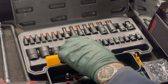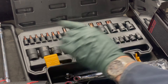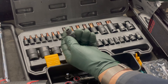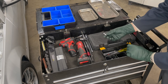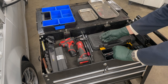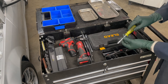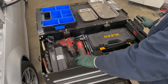I believe the most important thing you'll need is a good set of Torx bits. I like these because you can actually read them — T40, T30. And here are E-Torx sockets all the way from E24 down to E4. You're going to find a lot more E-Torx bolts on these engines than any of the previous engines, and the most important one is the E10. You saw all those fasteners around the valve cover — they're all E10 — so I have three E10 sockets.